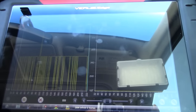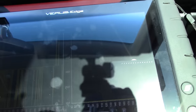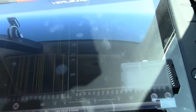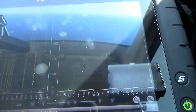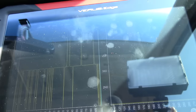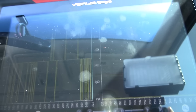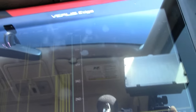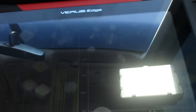All right, we're on the test drive. And the glare is there. I cannot do anything with the glare, but we can see the front brake solenoid is pulsing. We are at 0.62 amperage, and here I'm graphing the shifts. We're in first gear, and I hope that you can see that. This was going 0.01 when the solenoid would go open, and it would go into failsafe. That's fifth gear, front brake solenoid. There's more glare. Can't do anything about that.